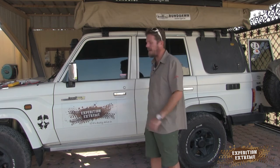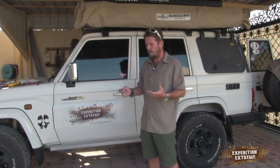So, busy packing up my truck. We're about to embark this afternoon to go on a short trip. And the vehicle's pretty much packed up. I opened up the kitchen compartment where I have a voltmeter, and my dual battery system is running at 9 volts. So my batteries, my yellow top batteries, have died. Now, let's get into the battery management before I get into anything else.